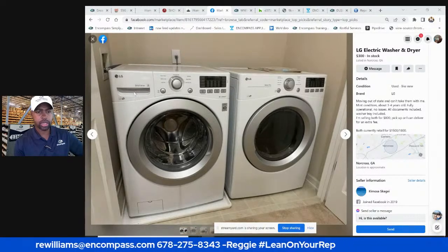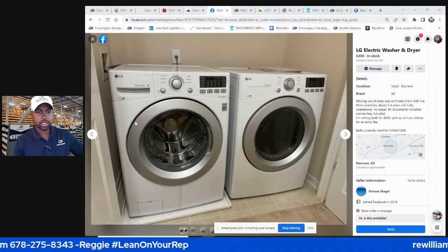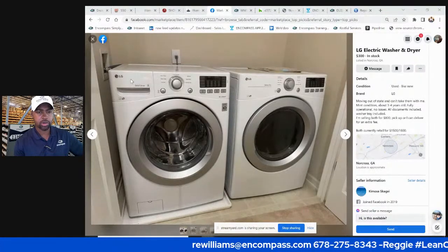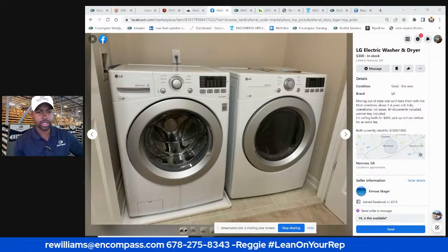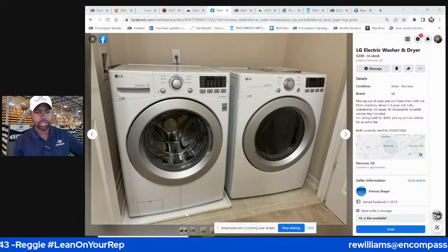And sometimes it comes from here, this laundry drawer. So that water will come down into this seal here, into this frame, and then it will leak out right here. So something happens to it, opening this drawer up, or it's not closed, or, you know, you never know what people do. But I'll definitely expect a tub seal. Sometimes the glass will have dirt on it, and that will break the seal, and so that water will trickle down.